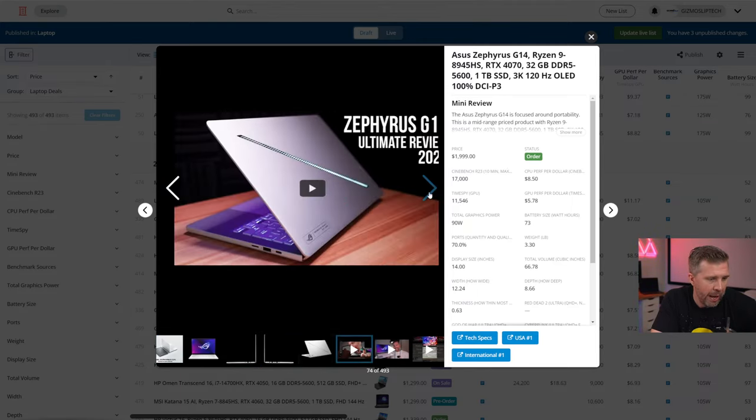So here we are in another test for the Zephyrus G14, the second graphics test in Time Spy. Again, 90 watts being utilized on the RTX 4070. And over here on the right, only 58 watts, 65. Okay, now we're getting up to 65 watts. It took a little while to update that wattage. But the boost clock is definitely lower. Temps are lower. This is the kind of thing that makes you wonder why they didn't just shift more wattage from the CPU up to the GPU. You get more boost. I feel like through a software update, they might actually be able to boost performance on the Omen 14. If they could just shift 10 to 15 more watts from the Intel up to the GPU, at least in GPU-bound games, I bet you'd see a significant performance boost.